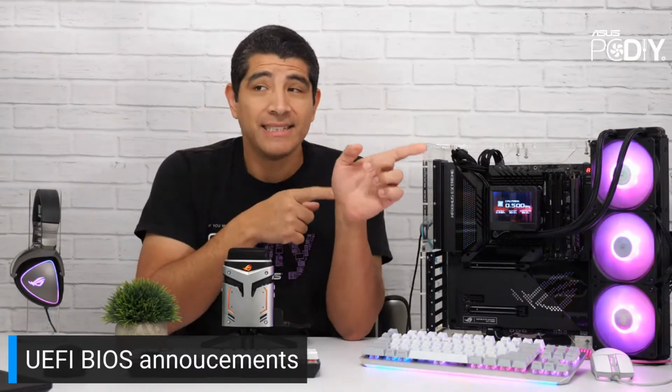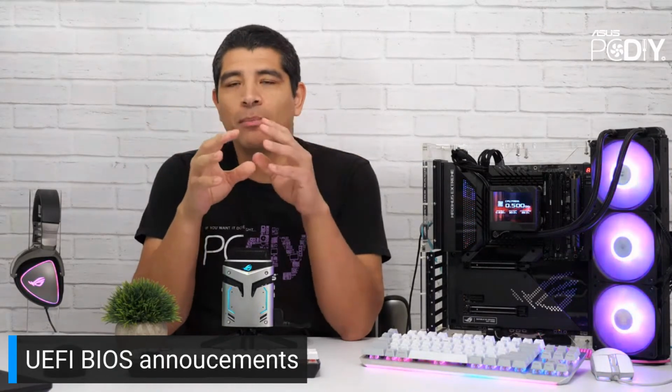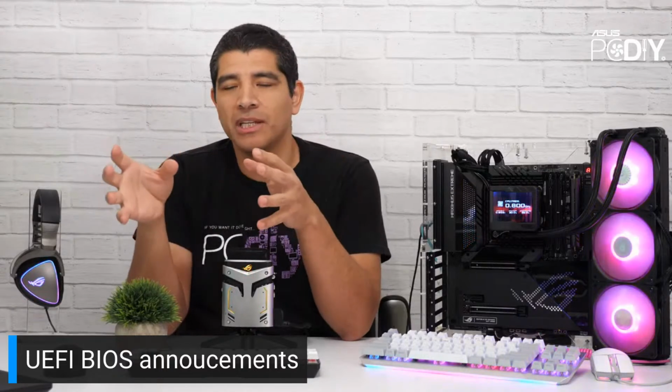This is actually following up on last week's stream update. If you've got one of the newer Z690 series motherboards, we have been releasing some new updates over the last couple of weeks. The last set of updates is a little more important to keep in mind because it includes a few items. There's new Intel Management Engine firmware, which is important in terms of security, performance, and a number of aspects of the way the motherboard works in relation to the CPU. There can potentially be other supplemental firmware as well, so you want to make sure to not only flash the UEFI, but there may also be additional supplemental tools that you'll have to patch in.